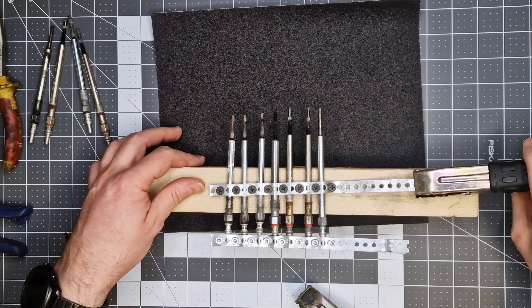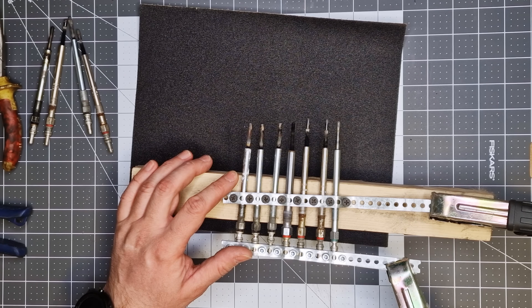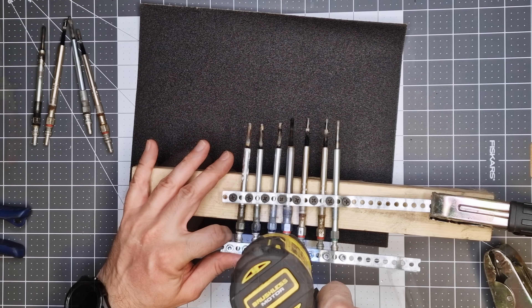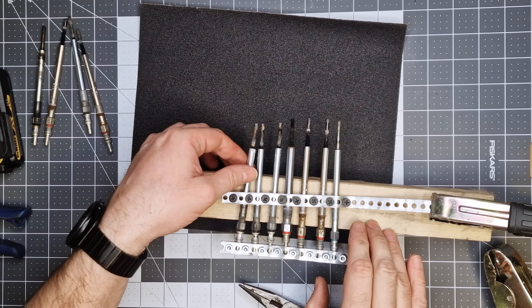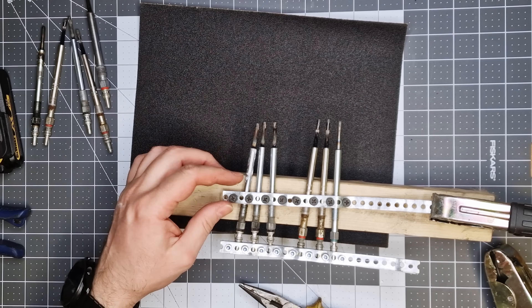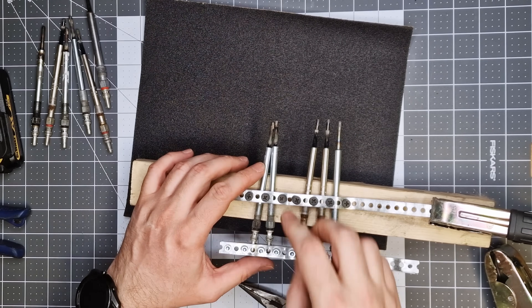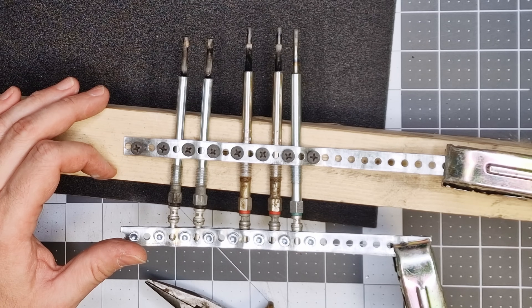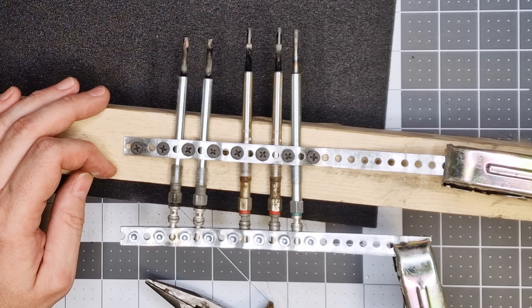I connected the car battery using jumper cables — and nothing happened. Well, something did happen, just not what I expected. The jumper cables became extremely hot to the touch and nearly scorched my hand, but the glow plugs barely warmed up. The current draw was too high. After removing some glow plugs and trying again, the cables were still overheating and limiting the current — so the glow plugs barely got warm. My ambitious experiment completely failed, and that's really frustrating.